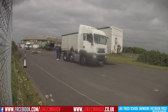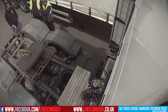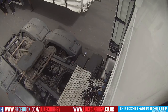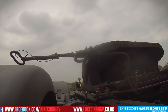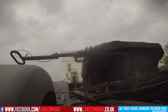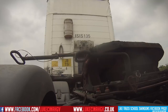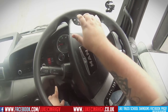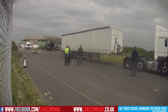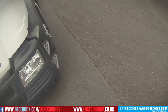Later we'll check the lights when the Susies are connected, but for now the trailer is good to connect to. So we jump in the cab, drive forward, and line ourselves up with the trailer. Bear in mind this is how you recouple in test conditions — you pull short of the trailer, get out, and physically check with your eyes that you're lined up correctly, not just relying on your mirrors. So I'm getting out of the cab, walking around, making sure I'm lined up and can eye up the kingpin.